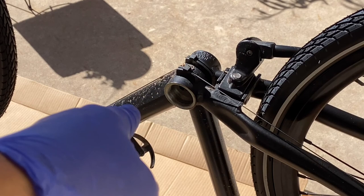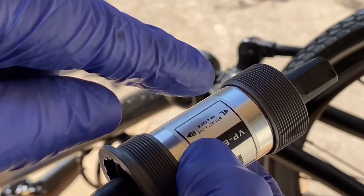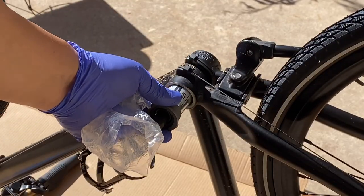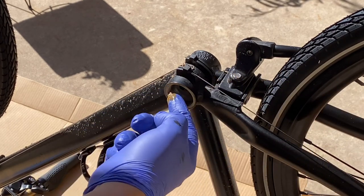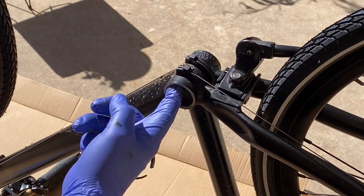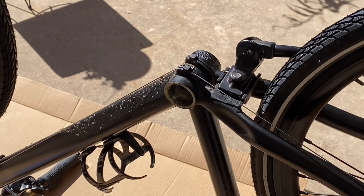Once you've cleaned the inner housing and you're ready to put in your sealed bearing assembly bottom bracket, just bear in mind that the right side goes to the left-hand side and the left goes to the right-hand side. Before installing, you want to lube the threads — just a little bit of lube. The reason is you don't want it to seize over time should water, dirt, and grime get in there. You want to be able to take it off easily the next time, just like we did a little while ago — just a few taps and it came right off. Do both sides.